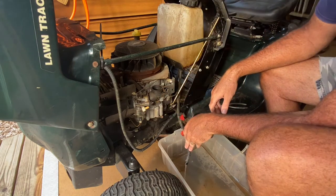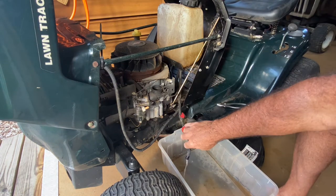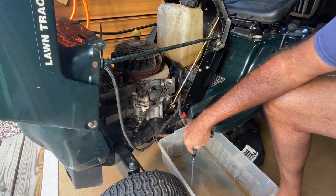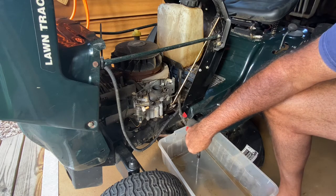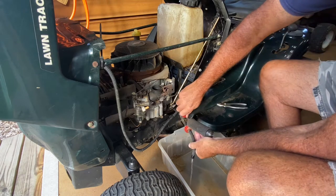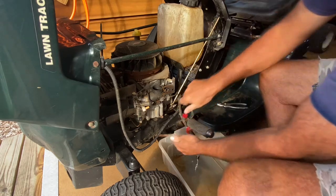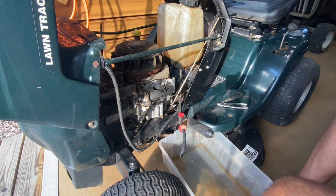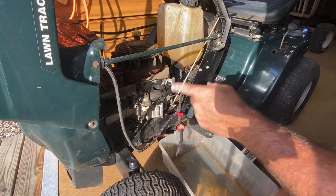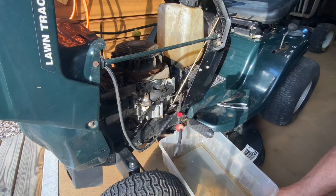There was a little nasty in the bottom of that tank. I'm gonna run it for a minute. The first part was milky — I probably just filled up the carburetor with milky gas. I'm gonna shut this back off. I could just empty that bowl out and be good to go, but since it's right here with easy access, I'm gonna take the carburetor off and just do it right.